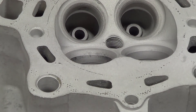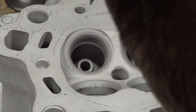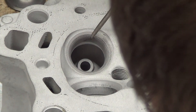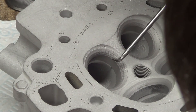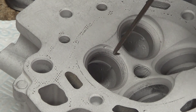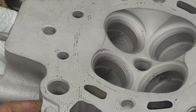If we bring you in - this is the first cut, this is the second cut, and this is the third cut, so these are three-cut valves. The weirdest thing is that the third valve cut gets really thin. It's this depth here, and then there's the seat, and we are pitted quite badly. Usually I would protect the valve seats, but I knew I was going to re-grind these anyway because I could see this pitting - you can see all this pitting here that's going to need to be ground out.